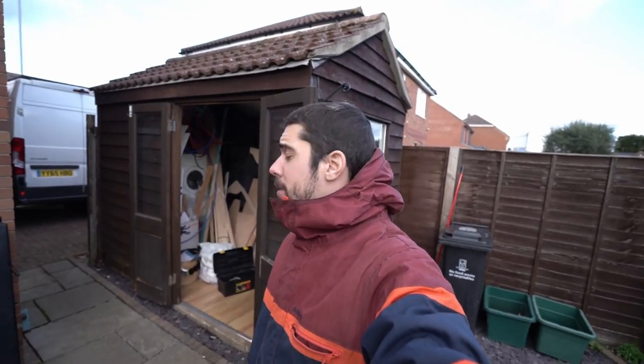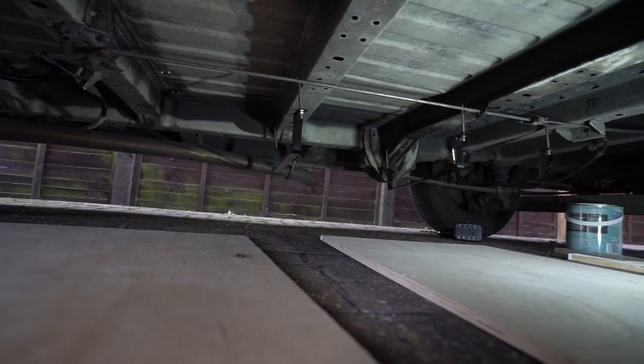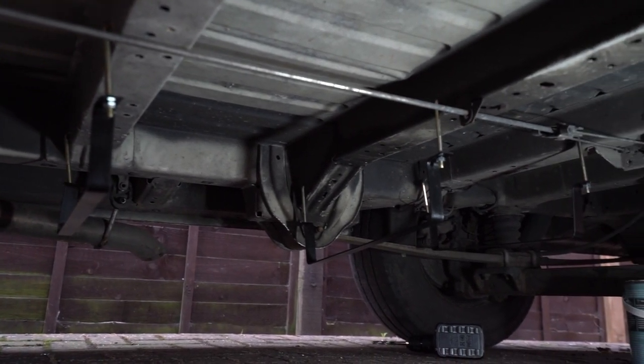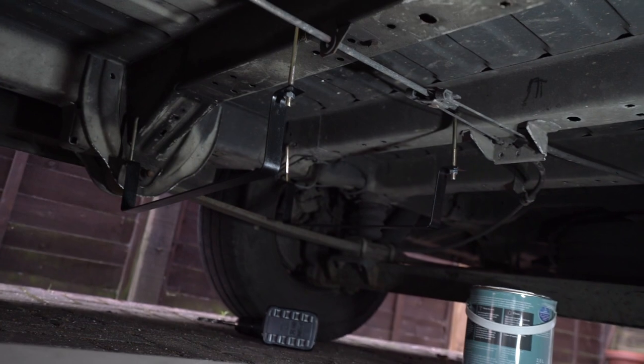Just been under the van for about the last hour trying to get these holes drilled and then add the hooks. The two things in the way are the handbrake line in the middle of the van — you've got to make sure the hook is not too close to that — and on the left-hand side one of the beams has a little kink you need to work around. With the hooks, you can't put them too high on the beam otherwise you can't hook it in. You need to drill your holes roughly an inch or two centimetres from the bottom and then they hook in just fine.